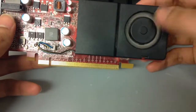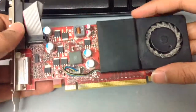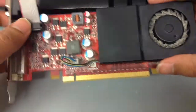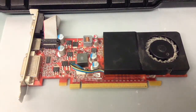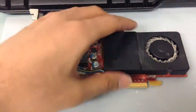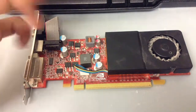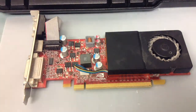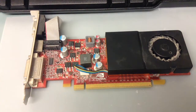As you can see, it's really dusty. The fan still turns quite well, but I'll be wearing a mask during this so the dust doesn't get in my nose — so my vocals will be a bit muffled. I won't be talking much in this video either. The first thing I'll be doing is removing these screws and taking off the heatsink, cleaning that separately, then cleaning the entire card, and applying thermal paste and putting it back. That's basically all you can do for a refurb of an old graphics card like this.